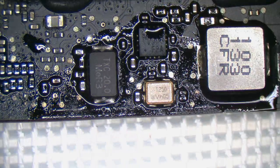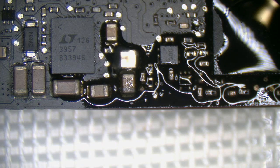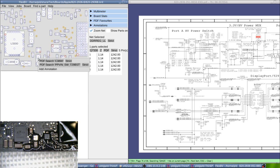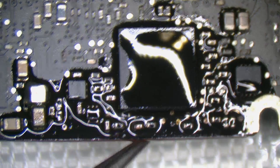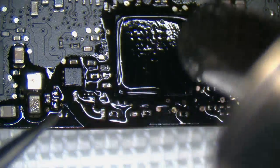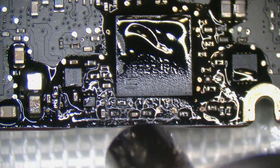Let's have a look at the SMC area. I'd say this big cap here was pretty beaten. That there is Thunderbolt. My main concerns originally were with these three parts down here. A lot of this stuff can take a fair bit of corrosion, but there is certainly a threshold after which it can cause problems. See how it's gone grey right down on the pad as well — there could be corrosion under the SMC, so we may have to reflow that. If I had to pick something, that there would be the main trouble. A close second and a third — though the third actually looks like it's cleaned up.